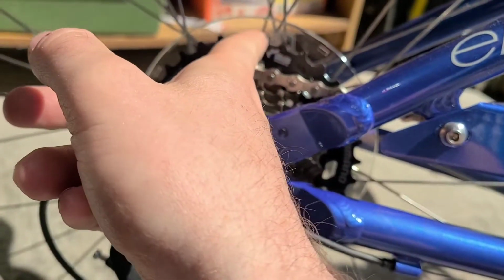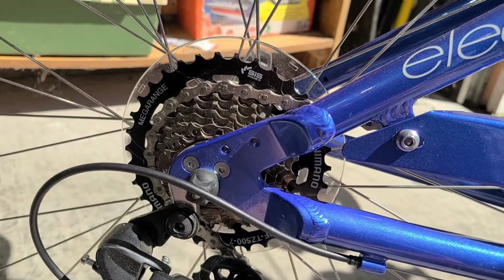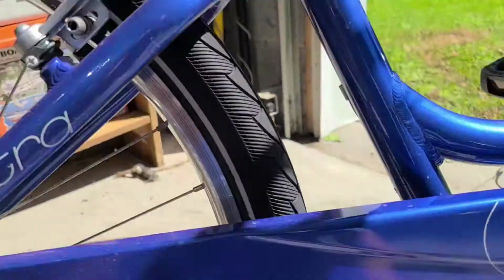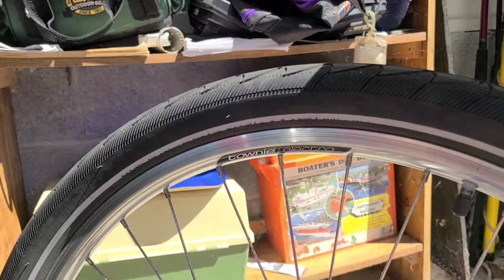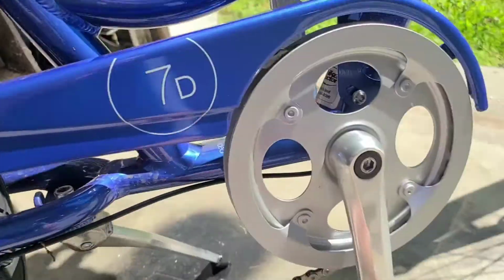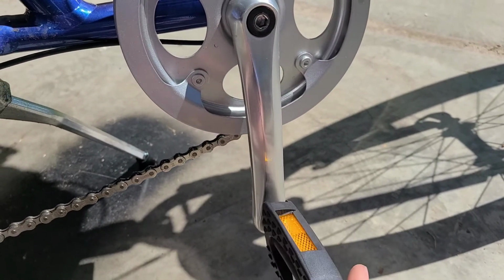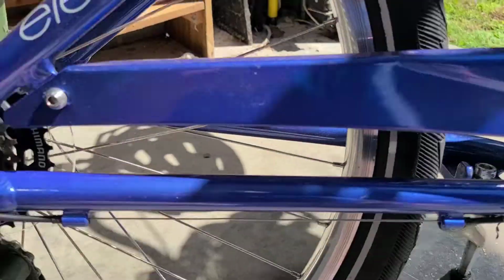of teeth on this sprocket, such that one turn of your pedal might turn this tire by only a third of its circumference. In other words, if you want this wheel to go around one time, you might have to run this pedal around 3 times. That's a lot easier on you to pedal, but you're not going to quite go as fast.